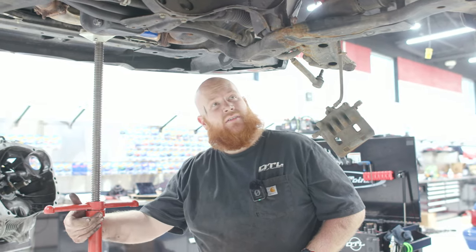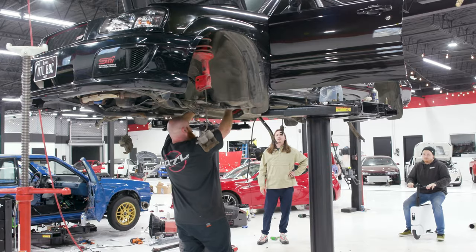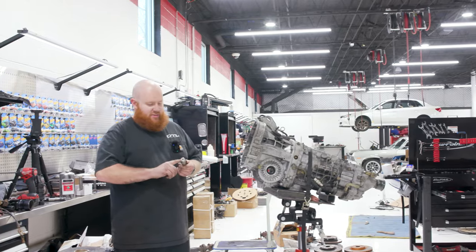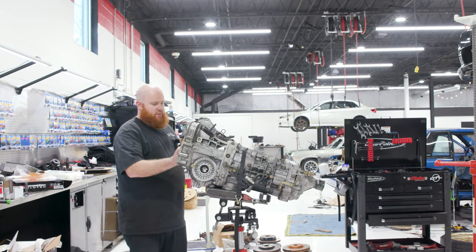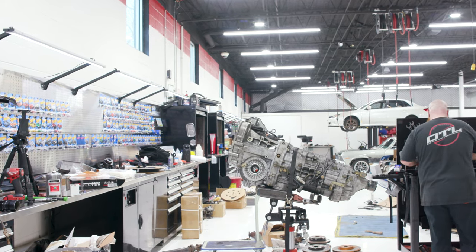Before I go any further, I want to put the 6-speed shifter assembly in. All right, we got that all loose. Now we'll just get the rear shifter bushing out. We're gonna grease our shaft. Get some of this all-purpose grease. Really slather it on there. I'm gonna put the excess on the fork. Pressure plate's on. New throwout bearing in place. Fork is greased. I need to get the speed sensor off of the old one.